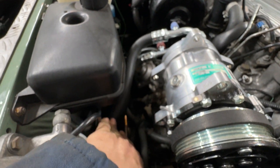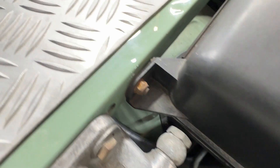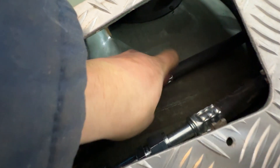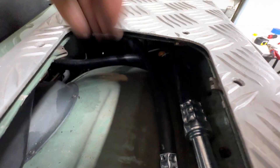Here are the lines that I've run — these are the hoses that were supplied, standard-sized AC hose lines. They are much larger than the reduced barrier hoses; I would have much preferred those as they would have been easier to run and more flexible. But once you remove the air intake box — the factory one from Land Rover — you've got all this room, basically like a giant trough to run all this stuff through, so I took advantage of that.